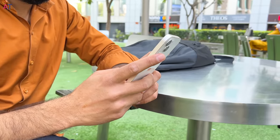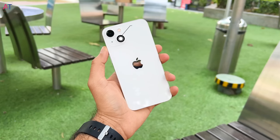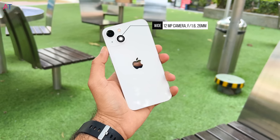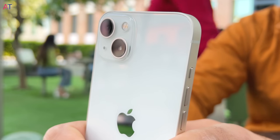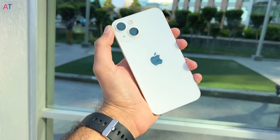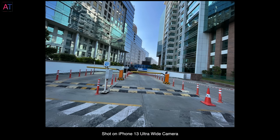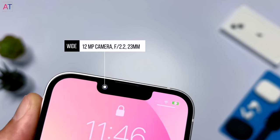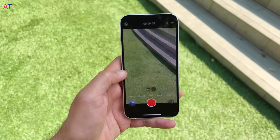The major difference in the iPhone 13 series is in the camera. Compared to iPhone 12, the wide camera lens is larger and captures better low-light photos. iPhone 13 has a primary 12 megapixel f/1.6 aperture 26mm wide camera with 1.7 micron pixel size — up from 1.4 micron in iPhone 12. The wide camera also features sensor-shift OIS instead of regular OIS, where the sensor moves instead of the lens, providing more stabilized video — a technology usually found in large cameras. The second camera is a 12 megapixel f/2.4 aperture 13mm ultrawide camera that captures 120-degree angle photos, same as iPhone 12 series. On the front, inside the notch, there is a 12 megapixel f/2.2 aperture 23mm wide camera.